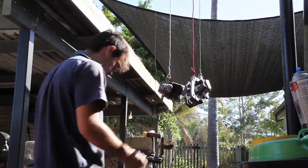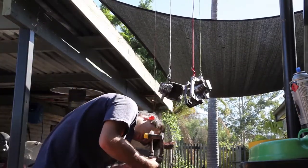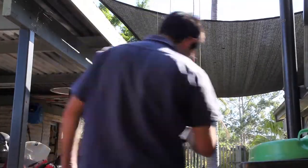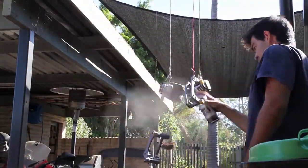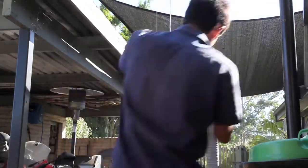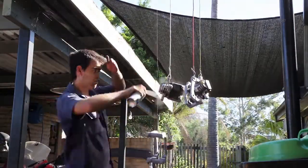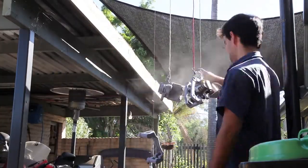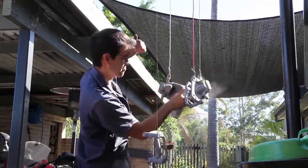While you're masking, mask up all your caliper seals, rubbers — just stuff you don't want paint on. When you've done that, throw some high heat primer down. Make sure it's high heat, because this is what will allow you to throw down whatever color you want. I'd recommend following the instructions on the can, but in my case I've just done two moderate coats about five minutes apart.